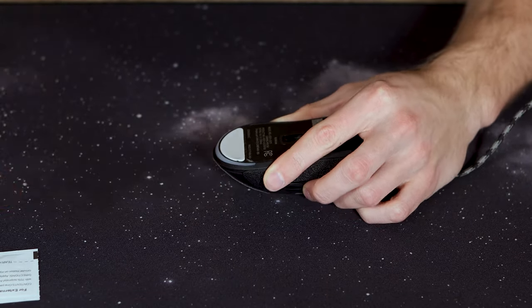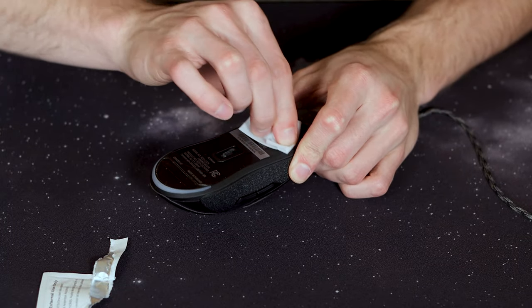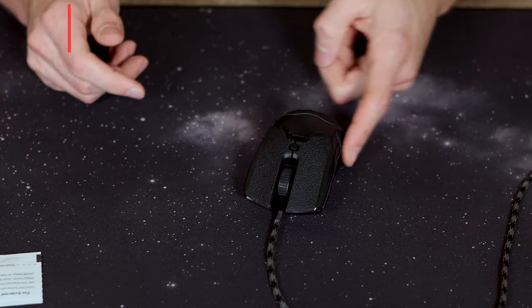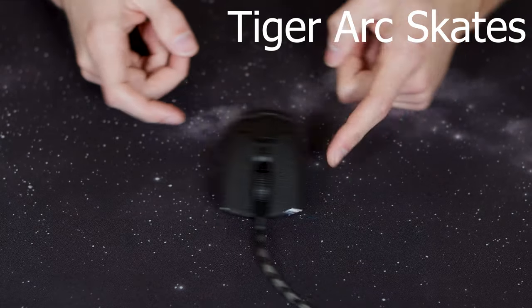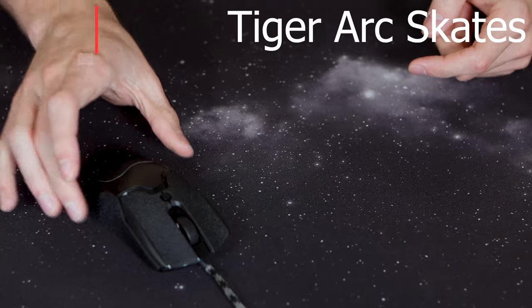Once you have them off, there was quite a bit of sticky residue left behind. They actually give you some nice alcohol wipes which you can use to scrape it up — it cleaned things nicely. Make sure it's dry, then take your new glides, peel the plastic film off the back, and put them on. Push them down for a bit to make sure they adhere well. For me personally, I can't tell a huge difference — they look very similar and feel very similar, though they do feel a little bit faster. Obviously if you're coming from a mouse with worse glides, or playing on a faster or hard pad, you'd see a more drastic difference.